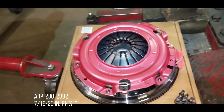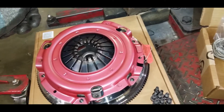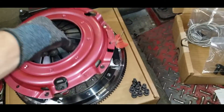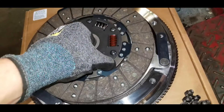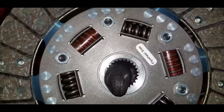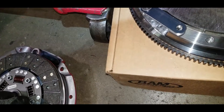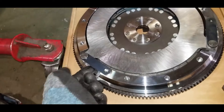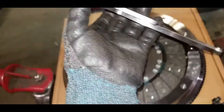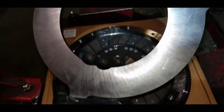Here is the twin disc. This is converting it from a pull-style clutch to a push-style clutch, kind of like what all the later cars are actually set up for. So if we pull off the pressure plate here — you've got disc number one. If you're concerned about which way it goes, they're labeled very nicely. Then what we have is a floater plate — it has these arms on it that are basically like a spring to take up any extra slack. Looks like spring steel, multiple layers.